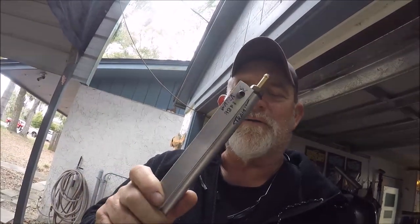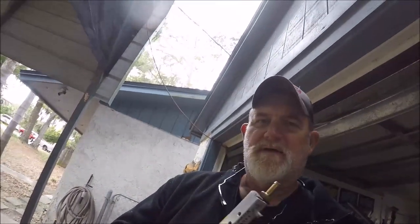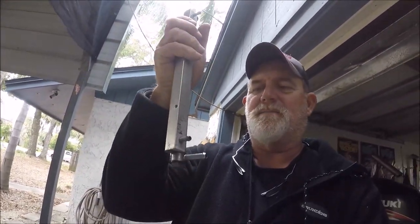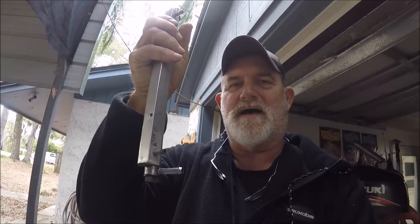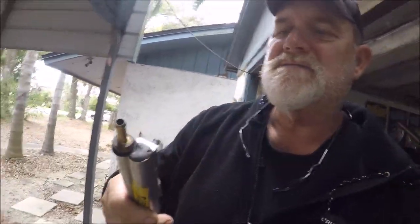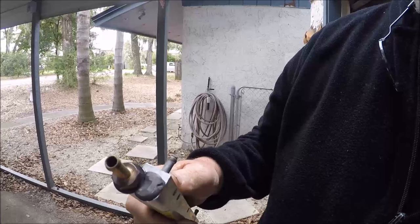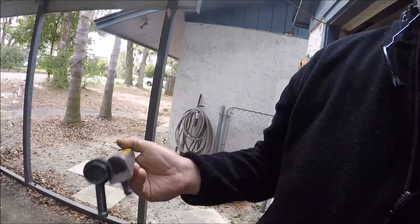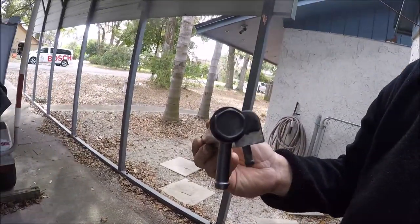This is the reason I do the flushing all the time. Not a ton of water is going in here. You've got fuel on one side going in this way, and you've got water going in here, water exiting out the bottom, and fuel exiting out the bottom. See what I did — I had to drill it out here because it has a plug in it, and I put JB Weld. That's because I had to clean it out.